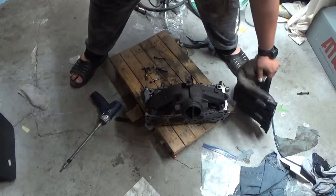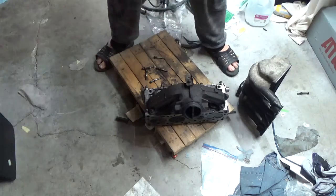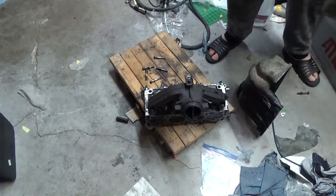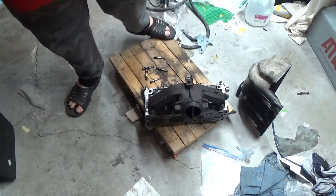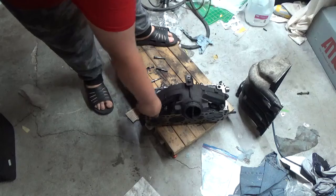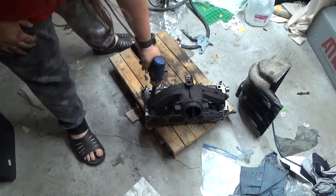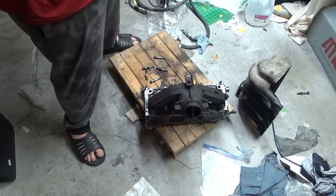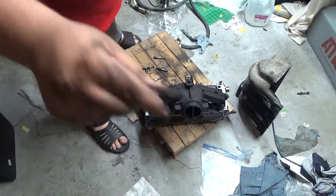Now, here's the fun part, folks, because I do believe that the battery in this thing is dying, and I was hoping that we'd get through all that we needed to with just one battery. So, nope, not a 10. Let's try that 12 again. Yeah, the exhaust manifold is 12. Yep. Kind of thought studs would come out and the nut wouldn't, because it's a cut nut.